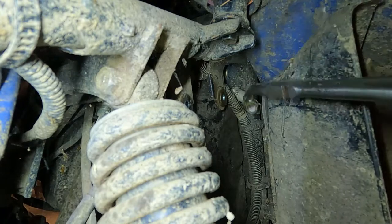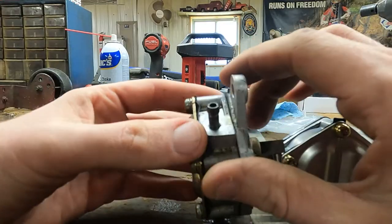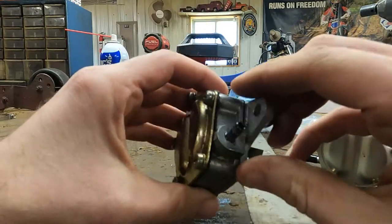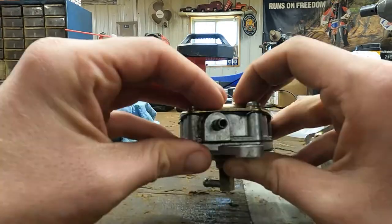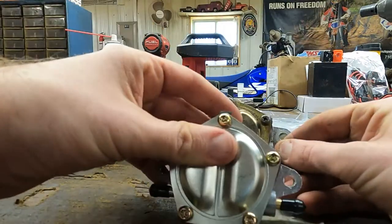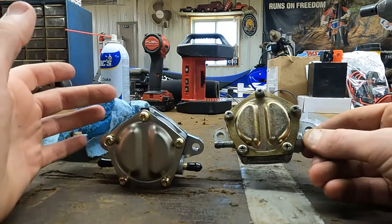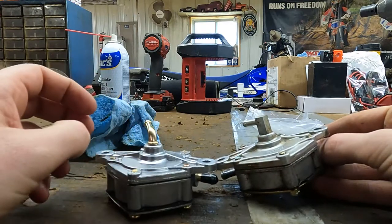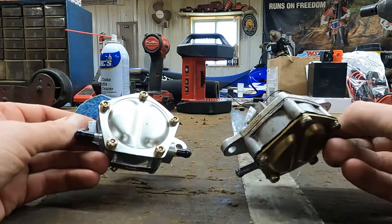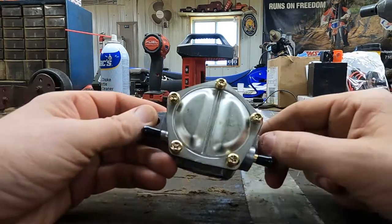See all that stuff falling out of there — that can't be good. So this is my old one. I cleaned it up to see if there are any markings — I found it says 'IN' right there, so that's the inlet side. I looked at my new one and it also says 'IN' on it. The inlet and outlet should both be on the same side, and they both have a pulse line. I got this on eBay, it wasn't much, but it was definitely worth getting a new one since this is probably the original pump — meaning it's 20 years old.